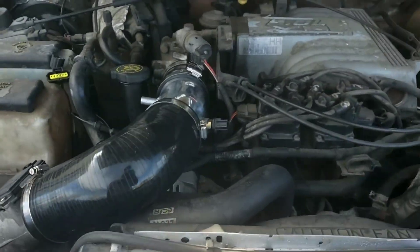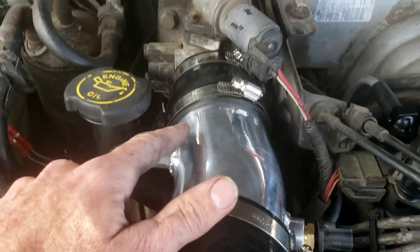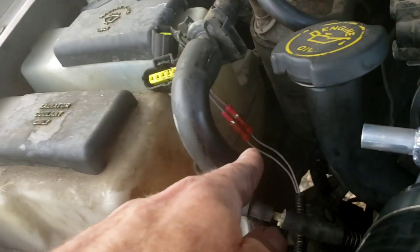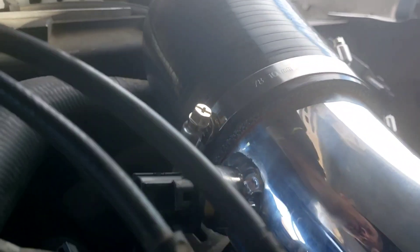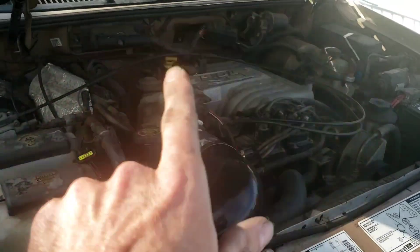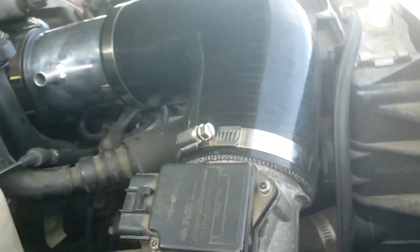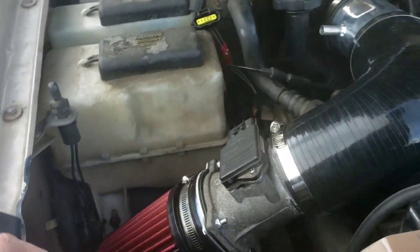We are back and there are a few things to fix or modify. The breather tube goes down there — it can plug in under there no problem. My sensor is already rewired and will come over here no problem. But this tube is a little bit too big, so I'm going to take some electrical tape, wrap it around that tube a few times to close that gap and tighten it. Same with this side — I'll wrap some electrical tape around the mass airflow sensor to close that gap so there are no air leaks.